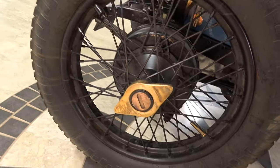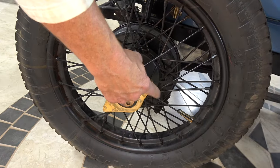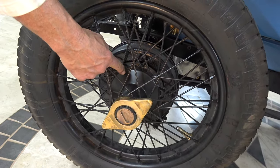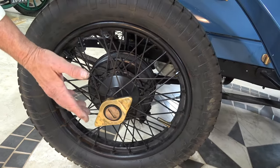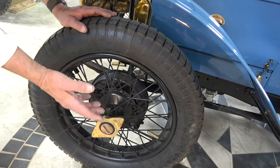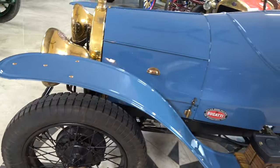Tell me about these knockoffs. These knockoffs — you simply hit them with a leather rag and a lead hammer and they spin off. There are 144 splines. The car weighs 1,100 pounds and you only have 300 or 400 pounds on the front end, so you can lift it and change a wheel in literally seconds, and you're racing ready to go again.